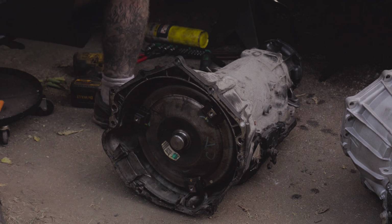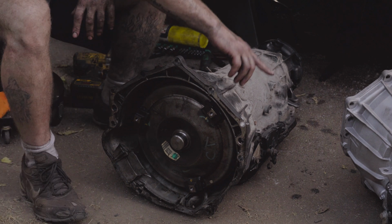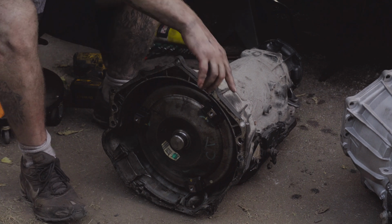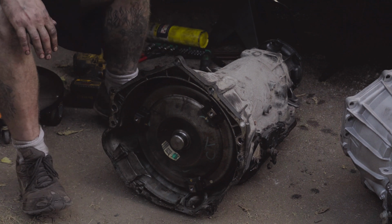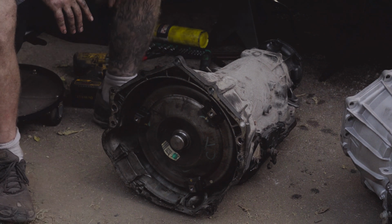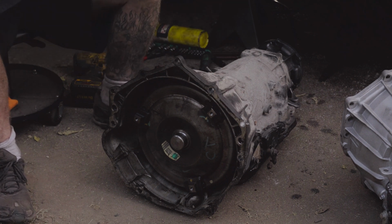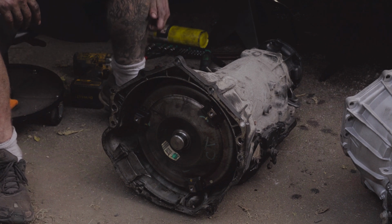And it goes the same way on the driver's side. There are your fuel lines that run up by your firewall and up towards your intake, and the bracket bolts into your bell housing bolt. You have to loosen that nut, pull that off, then you have to fight with it to get behind that to get the bell housing bolt off. It is a pain. This is the hardest part of this, getting these bell housing bolts loose.